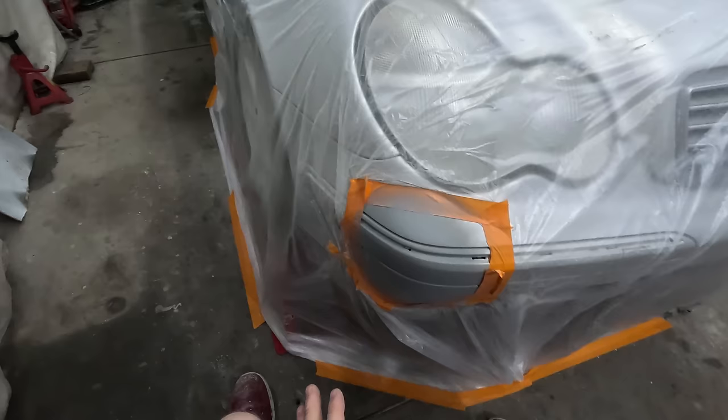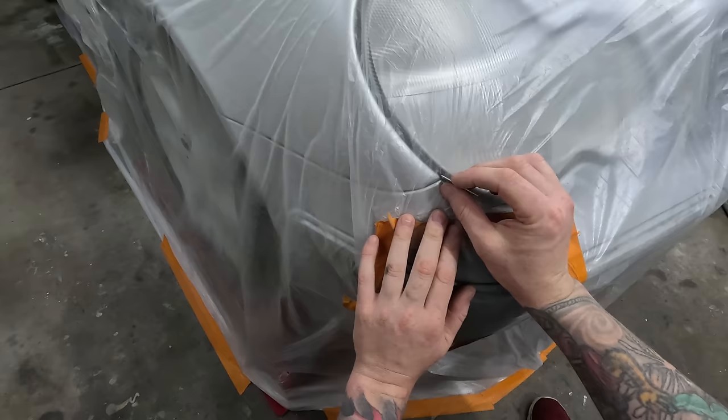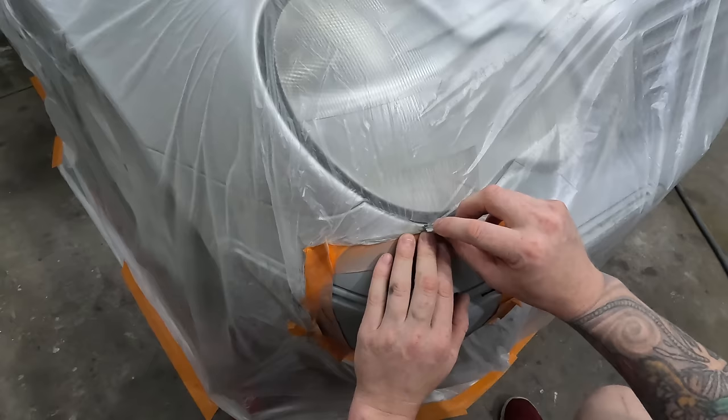A small repair like this, I'm just happy to do where it is now and just mask it up once. So put one piece of plastic over it, small, do your repair, and then just open it up when you're ready to do your color. I find that saves a fair bit of time, and you can paint it where you repair it.